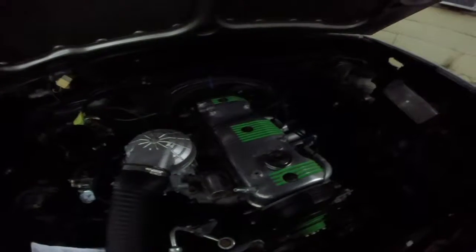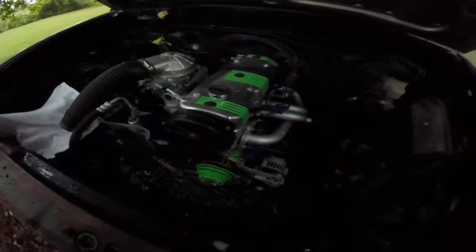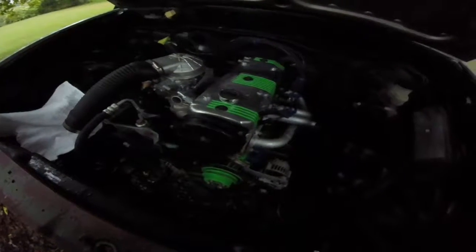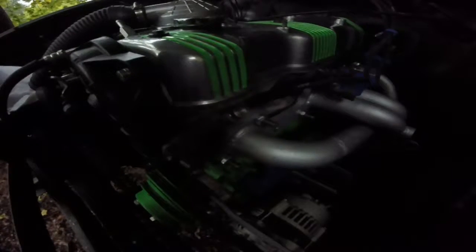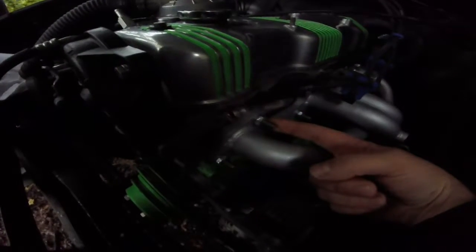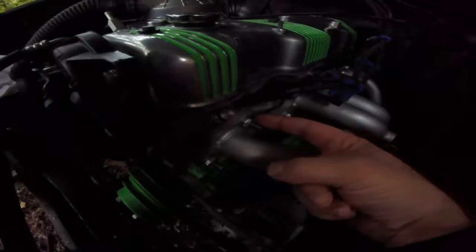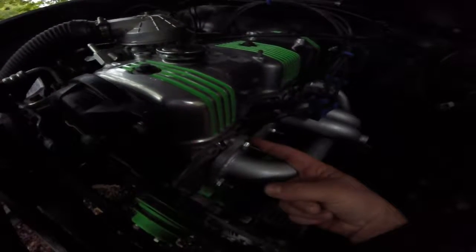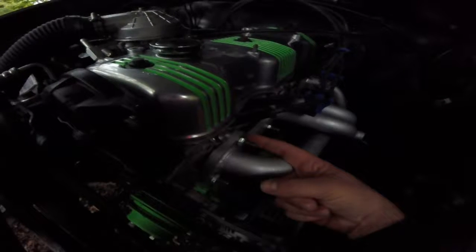It's a little hazy from the rain, but I did do the polishing on this valve cover — it's really just a nice simple setup. This thing is geared towards being what I would expect someone else to have, so that we can develop parts for it and make sure everything works. All of these studs here are all stainless studs. I left them a little bit long because I wanted to mount wire holders on them. We also use zinc nuts or black oxide nuts because stainless on stainless threads tend to grab each other, and when you go to take them apart you wind up ripping all the threads off or they just won't come apart at all.